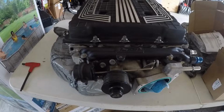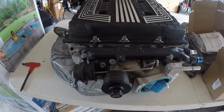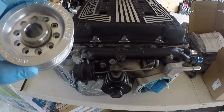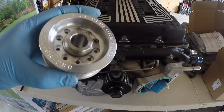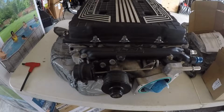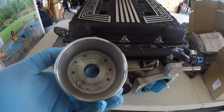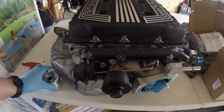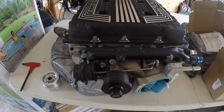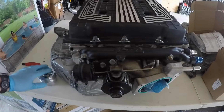Then, once we upgrade the fuel system and get things tuned, we might start playing around with different pulley sizes. That's what's neat about this particular pulley I mentioned in one of the previous videos. This is from ADM, and I got the hub and the pulley. This is the recommended pulley from ADM. You can see it's got the 6 ribs, and it's 2.8 inches, and it's meant for stock applications when you do a swap on an L83 or even an L86. But since they give you this hub, you can change out pulleys by just undoing these hex screws here and getting different sizes. ADM has assorted sizes that you can choose from for the boost ranges that you want. And there are others out there, as I mentioned in previous videos, like Grip Tech and some others, but I decided to go with ADM.